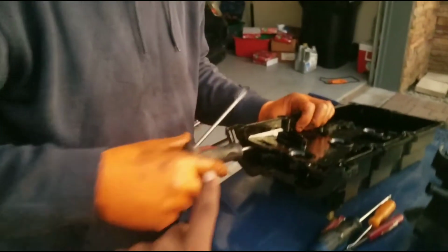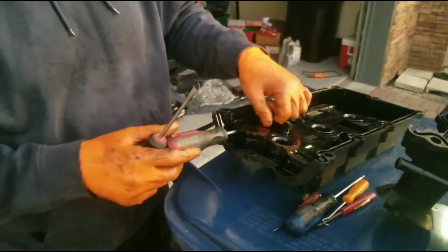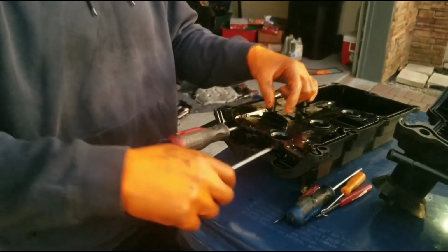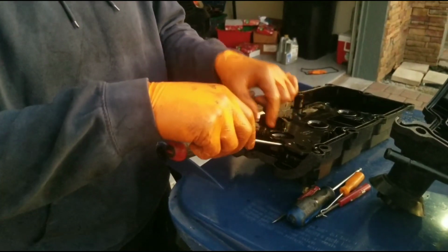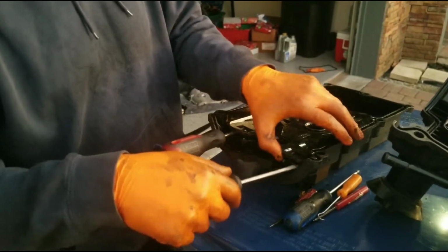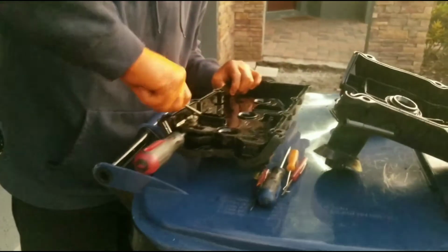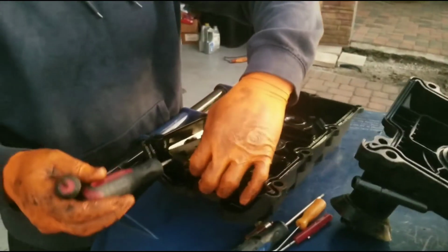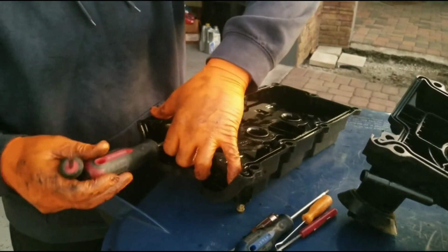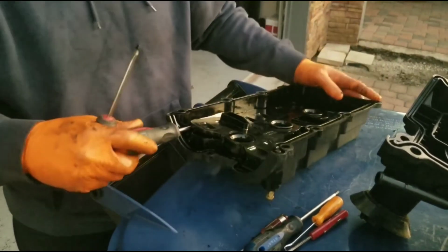So why are you using this screwdriver on that side? Because it helps as you put in this tension up. So when you are prying from the other corner with this tension, it helps to keep popping and lifting up, breaking away the glue. Once it comes loose like that, just lift up and keep pushing it in. So that way tension is always applied.